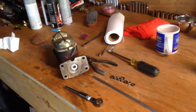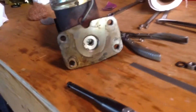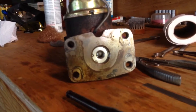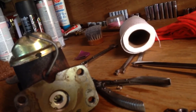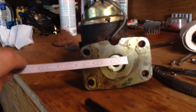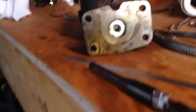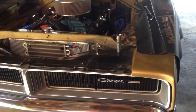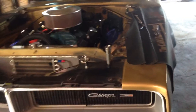What I might be behind the times on — I know people on the forums figured this out — but my problem was we're using a power master cylinder here with the 1-and-1/32-inch bore, and we put it on the manual car. This 1-and-1/32-inch bore does not put out enough line pressure to work for the disc brakes. It only puts out about 600 pounds of line pressure where you need about 1,200 for the discs.